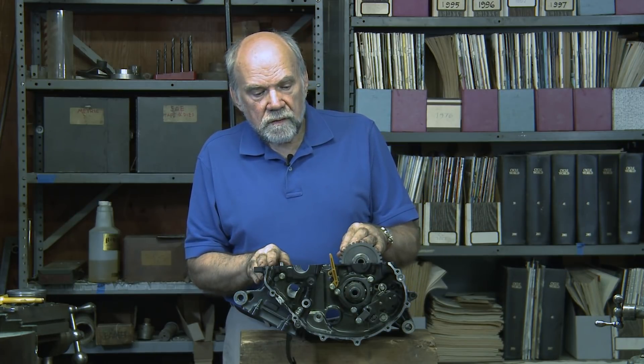Vertically stacking the gearbox shafts allows the engine to become shorter, to have more of its mass concentrated forward, to enable the motorcycle to do what it does best, which is accelerate. Motorcycles accelerate wonderfully.